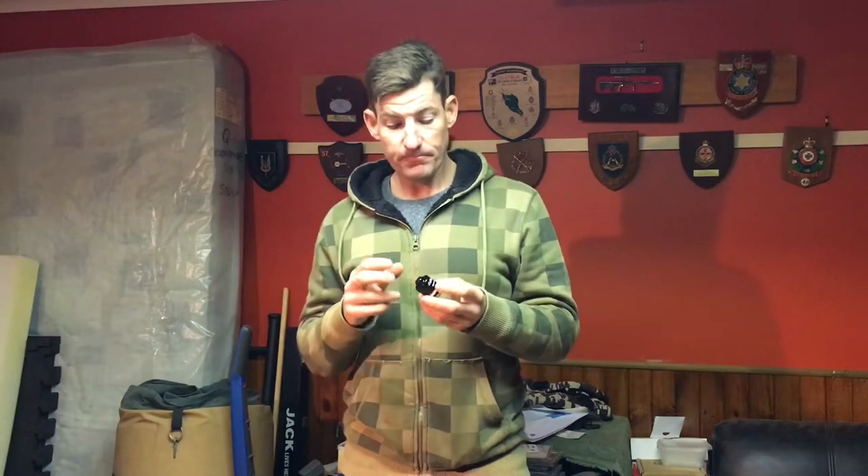Since I had room to remove that extra token, I dropped back to one token and my forks are absolutely perfect — as good as I've ever felt on a fork. The Luftcap made the fork feel too progressive and too choppy, and to eliminate that chop I had to drop pressure too much, which caused a flat spot — soft and diving then real harsh — instead of that consistent, supportive softness. You want it soft to hit but firm to ride on: it carries speed, doesn't get darted, doesn't get upset. I couldn't get that feeling with the Luftcap in.